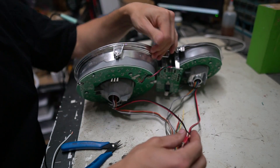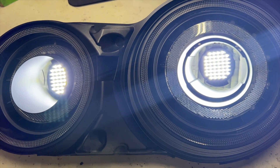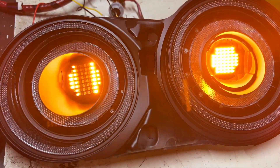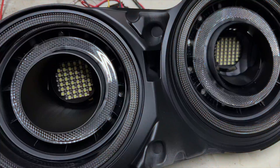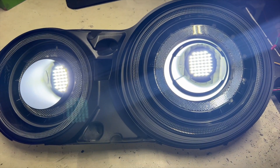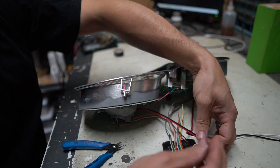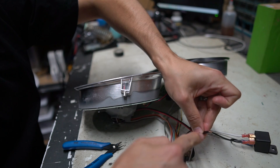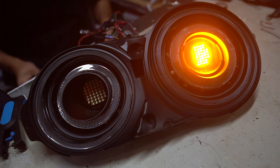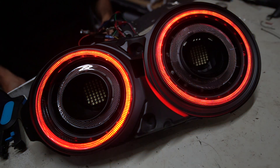Let me show you the madness coming off of these things really quick. We have our power and ground for just the reverse lights alone. If I power those things up, they look great. But the thing is, this is also a ghost sequencer that needs to have power at all times, so that these things can work with the car on, with the car off, anytime. So we don't want to have the power and ground connected to our reverse lights at all times. What we're going to do is disconnect the ground and instead take the signal from the car and send it down this little white wire. Meanwhile, this black wire goes to the ground right there on the main vehicle harness, and we put a connector on here to go into this relay. Let's check a couple functions — we've got our turn signals, and let's see how those things look when we have our parking lights on as well. Look pretty cool.